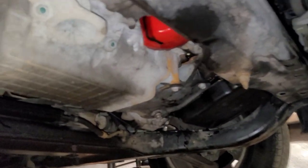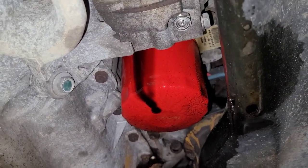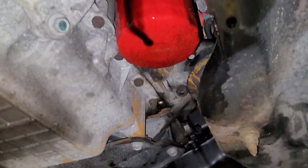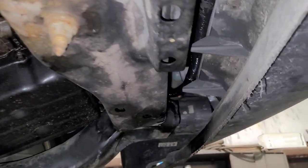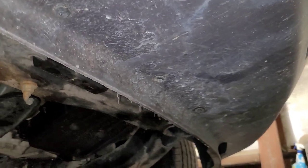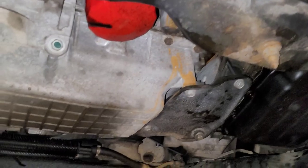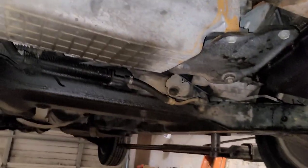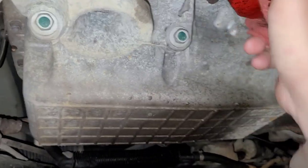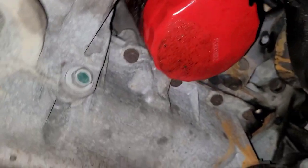Up in the air — well, that's kind of interesting. The oil filter's leaking. I can hear coolant dripping up there. Can you see the stream right there? That's actually coming from up high. Let me tighten up that filter real quick. I don't know why that would be leaking — oh yeah, it wasn't tight at all. I got about three-quarters of a turn out of that thing.